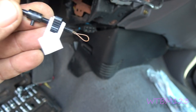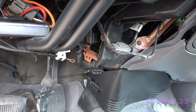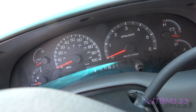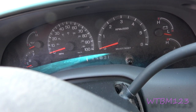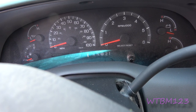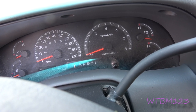Now we just got to hook this loop over the arm and put this all back up with the pin in the right place, then do some adjusting. That little black wheel we just put in there — if you turn that and look, you can see the park indicator move. So you want to just turn the wheel until you get it up there to park. Once you get it right in the middle of park, you want to put it through the gears and make sure it lands on each one correctly and goes back to park.